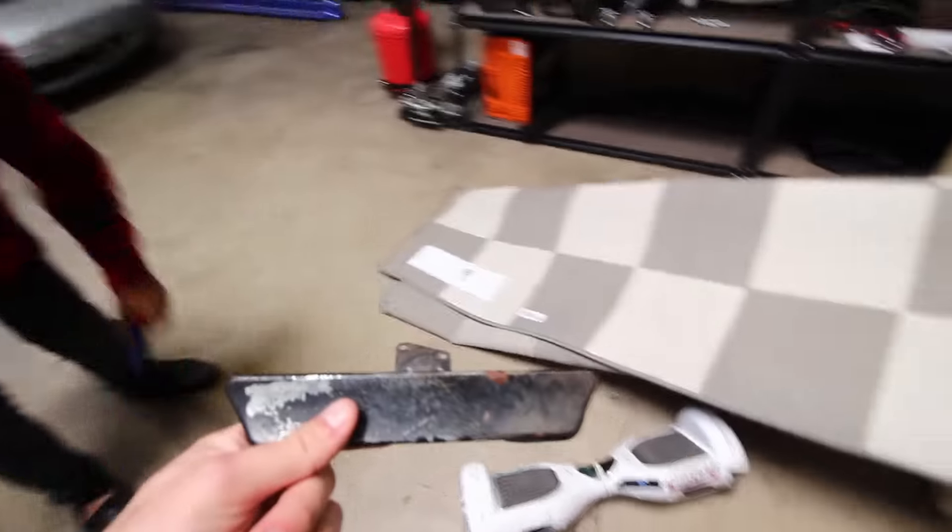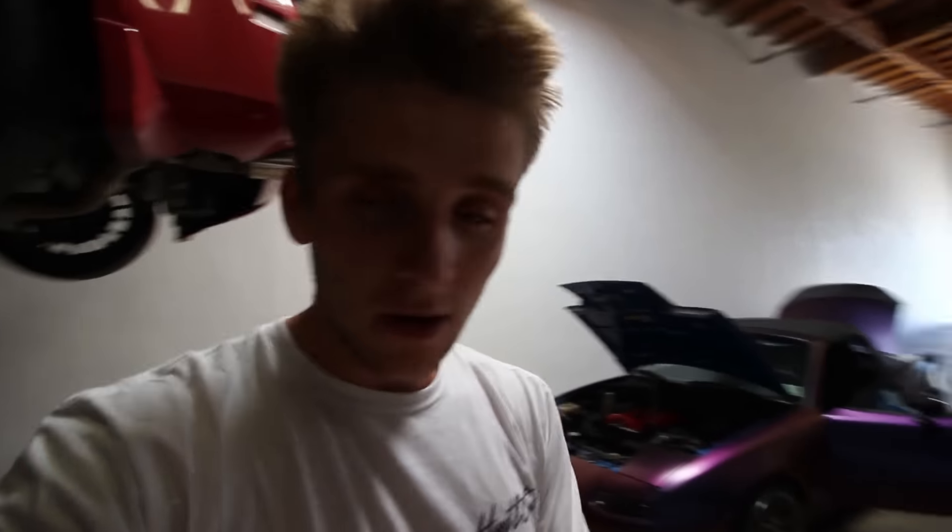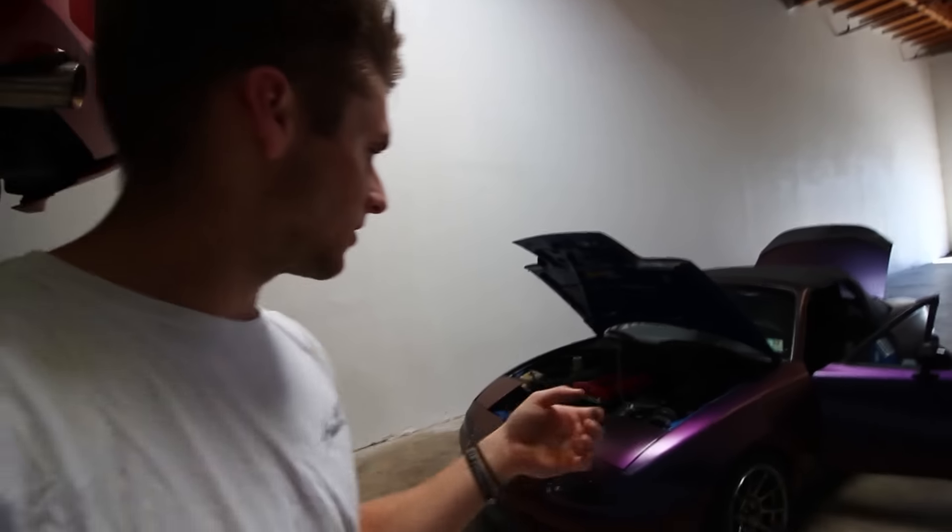I'll repaint it orange. So in today's video, we're gonna be installing a wideband O2 sensor. I don't have it yet — I bought it off someone from Throttle and the guys from Throttle are bringing it to me. It is an AEM wideband O2 sensor. This is the first video in the turbo kit series for the Mazda Miata. We need a wideband to see what the AFRs are for when we tune the car, making sure everything is not too rich or too lean.